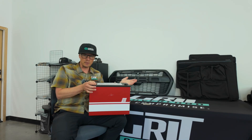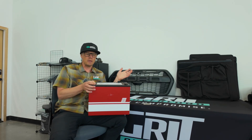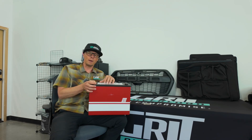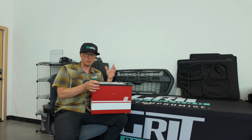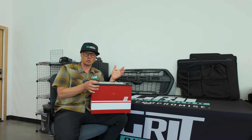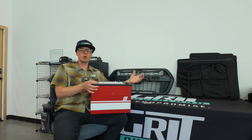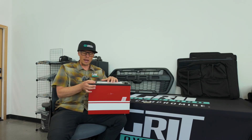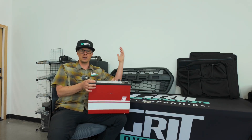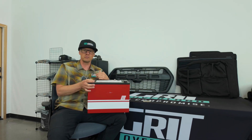Say the van's been sitting on the side of my house or in the driveway. It's cold. I haven't been using it as an RV. It's winterized, so I don't need to worry about it getting cold. Then I go out and I want the battery pack to be able to discharge and receive a charge. Lithium will still discharge when it's very cold, but it will not receive a charge well when it's very cold. So the biggest problem is the battery pack is cold, I turn on the lights and the inverter — it will do all of those things, but it will run itself dead before it can actually receive a charge.